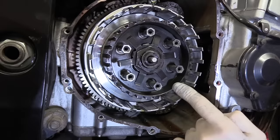Okay, on this particular casing, you've got two locating dowels to locate the case exactly in position. On some of the earlier models, you don't have that. And there's a little trick. All you need to do is take a bolt, a spare one or a couple preferably, and cut the heads off them, and then put a little slot in the end to make them a screw, like a grub screw. Screw them into the casing there like that. And then you've got a dowel.